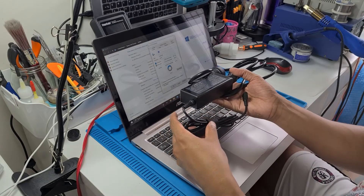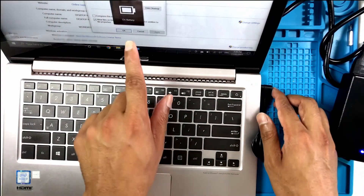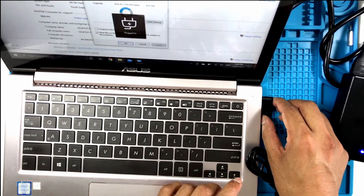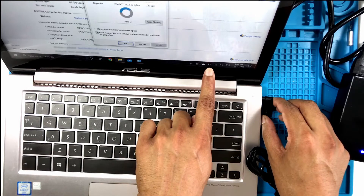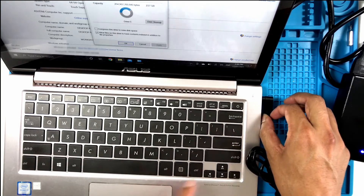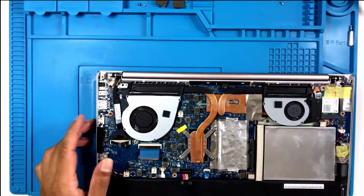I got a new charger for the laptop — let me plug it in. Blue light is on, and when we connect it there's no stable connection. It's plugged in at the moment but it's showing it's not, because when I move it around and hold it in a certain position it's charging, but as soon as I let go it goes back to battery. So there's a loose connection. I'm gonna open this up again and check the motherboard, see if anything is wrong with the charging port area.